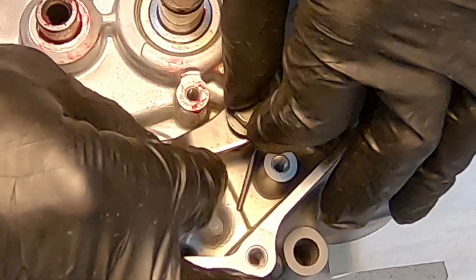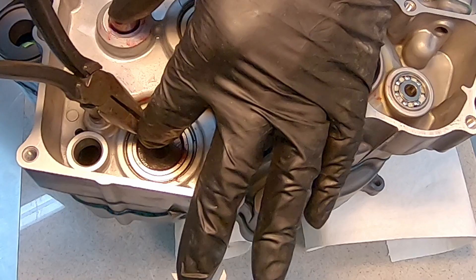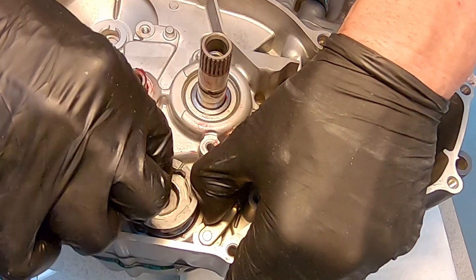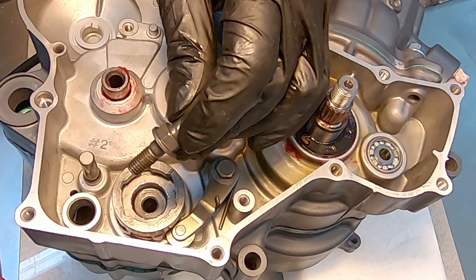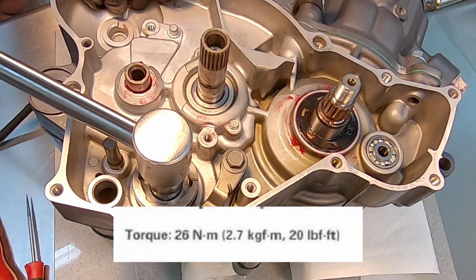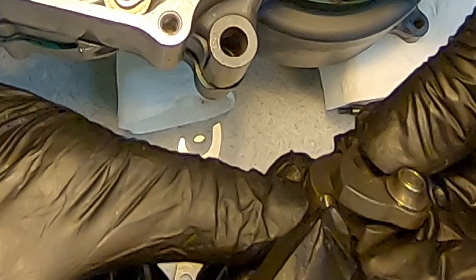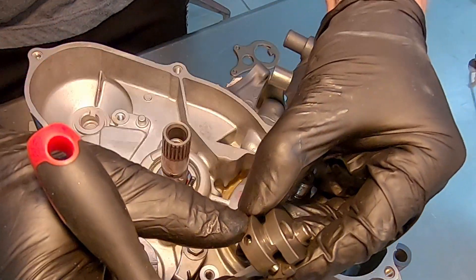This is the installation of the stopper arm. The long flat end of the spring needs to go against that boss. The book says to finger-tighten this, and after putting the pin in, they recommend pushing the stopper arm away with a wrench, but I found it easier to use my finger. The groove needs to align with the dowel pin - push the stopper arm away and put the cam in to align in that groove, then release the stopper arm. This is the center bolt, which has thread locker on it - install and torque as specified. Then torque down the stopper arm. Next, the guide plate and pawls installation - there's a spring and a little chrome pin that needs to line into that groove. Make sure the pawl is on the correct side.